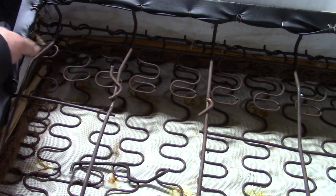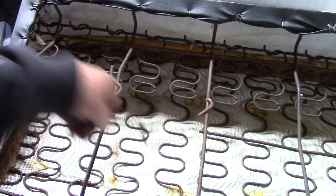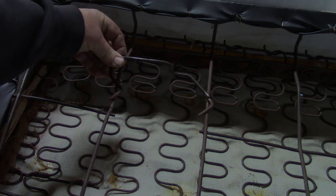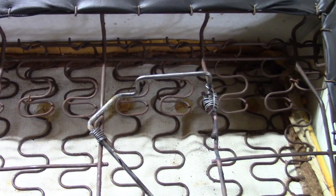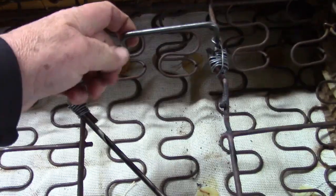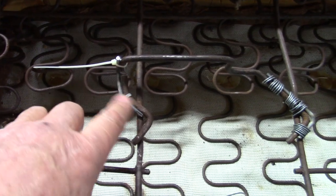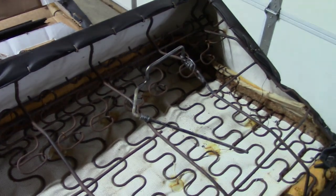It's really hard to tell exactly where they're going to sit, but this arrangement does give you some leeway. I wanted a way to test fit this before I welded anything, so I came up with the idea of just wiring it all together. I think it'll hold it pretty good until I can get it in there and make sure everything works. I'll use wire ties and then come back with wire and tie it as tight as I can, then check measurements again and get it in the car to see if it actually connects to the attachment points.